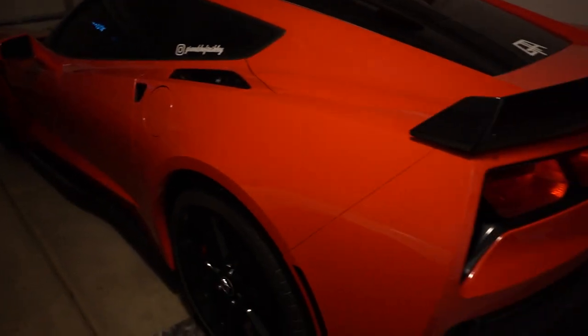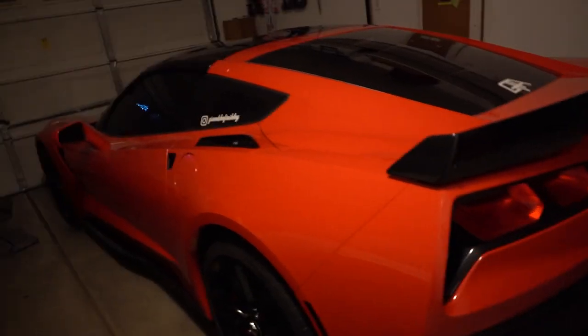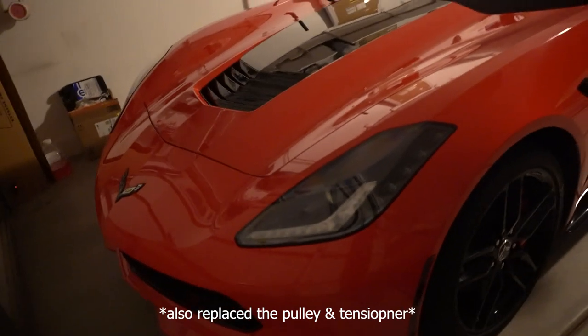It's been like two years since I last made a video, and it was when my car was stock. I think the first mod was the intake, but since then it has changed — it's not stock anymore. It's not where I want it to be, but I'll make an update video going over what I did with the Hellcat. There's not too much that I've done to it, but anyways, since then — this year in February 2022 — I might post this in 2023 depending on when I finish — I bought this C7 Z51 Stingray. It's been great. I ran into a few issues where the thermostat went bad, had to replace it. Replaced it with a 160, which obviously wasn't a good idea if I wasn't going to tune it, which I didn't, so then it kept overheating and I kept having to refill my coolant. Then I figured out I just needed an OEM one again, and that fixed it.